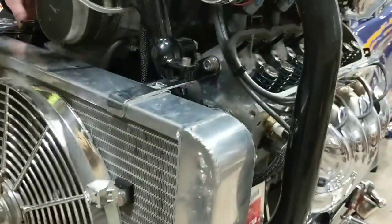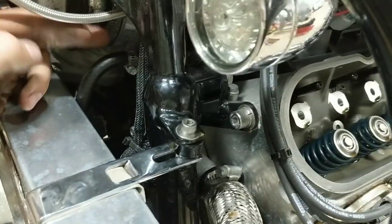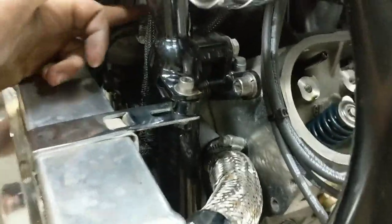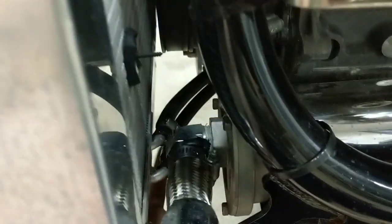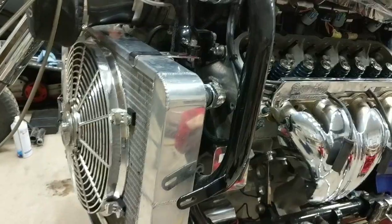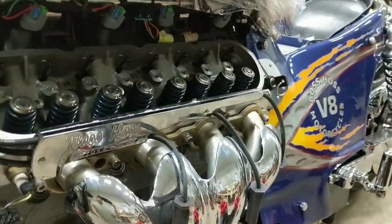Our radiator is now reinstalled. When you do this, make sure you do not forget to hook up your coolant bypass port or steam port. That's there to make sure any steam or air pockets in the coolant are properly cycled out because that is the highest point in the coolant system - there's no crossover at the front of the block like on a small-block Chevy. Coolant hoses are re-secured. Also don't forget about your transmission cooler lines on the bottom, as well as the electric fan wiring - the ground is on the side of the head and the single plug by your spark plug wires is the power to the fan.